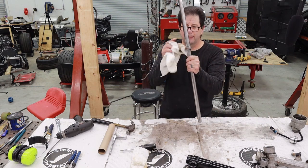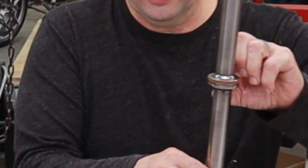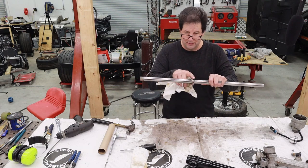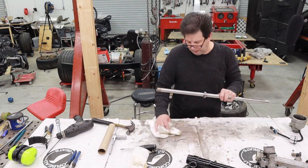That's the seal right there that we've got to remove. I don't want to get rid of this whole piece though — this is actually a stop; this is where your lock-to-lock actually occurs on this piece of metal. So what I want to do is just basically grind it down so that it won't have any kind of sealing ability whatsoever.